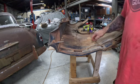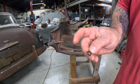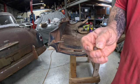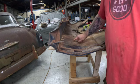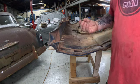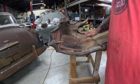Just like everywhere else, I clean up these threads with the wire brush and then lubricate them. Those all came off relatively easy — they're just the stamped sheet metal nut. Use a three-eighths deep socket to get them off. There's a little bit of a stud sticking out there, so the shallow socket wasn't quite getting it. But I've got them all off and now the molding should just come off.